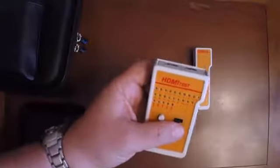This is very handy to have when you're troubleshooting a satellite receiver problem, or suddenly the satellite receiver doesn't want to turn on, because I've run into this personally. After an hour and a half on the phone with the satellite provider's tech support people, they started blaming my TV. I didn't quite buy that, and by process of elimination, I found out it was a bad cable. I unplugged it from the satellite receiver. It came online the way it was supposed to. I happened to have a spare cable, but that was an hour and a half I could have saved myself by being able to test it in just a few minutes.